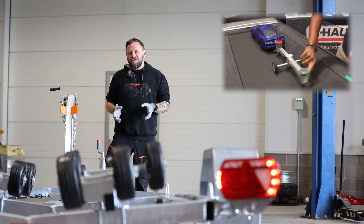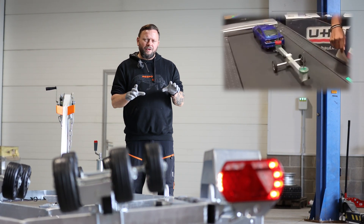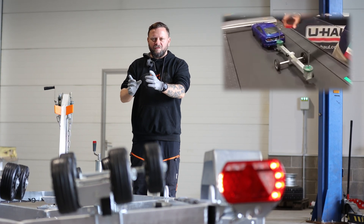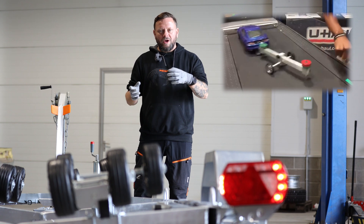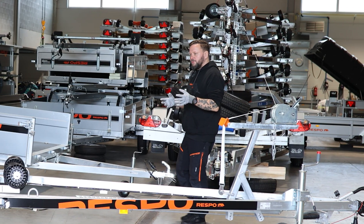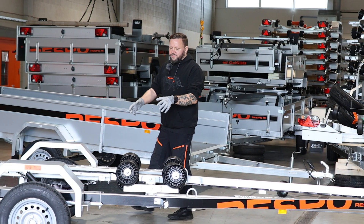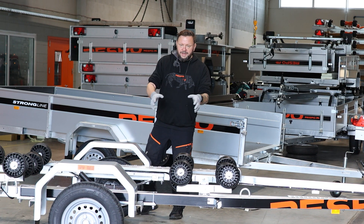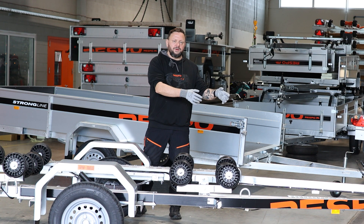While I'm here I thought I'd talk to you about an important topic which is trailer balance. Some of you may have seen the videos on social media where you have a little toy car with a trailer on a treadmill, and weights are moved around to show how weight distribution influences the driving dynamic. It's the same in real life — to tow a trailer safely you want the center of mass to be ahead of the axle so that the weight on the coupling is bigger than zero.